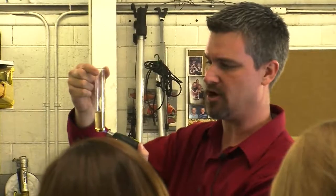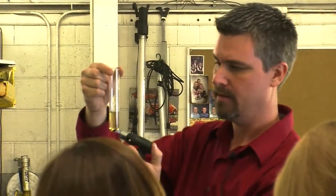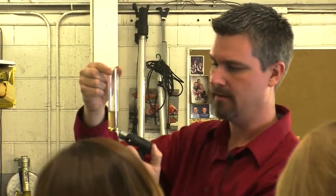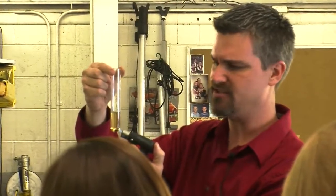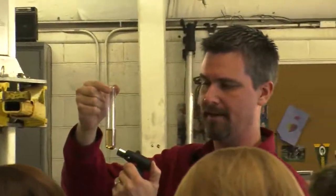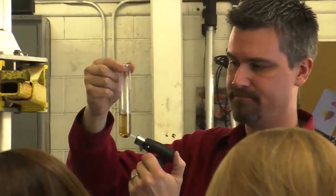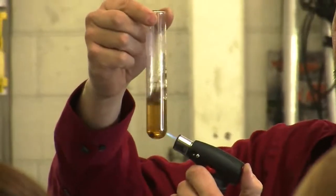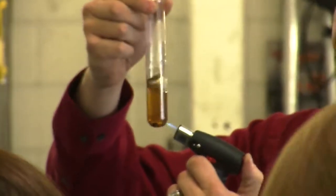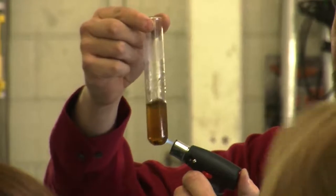We have detergents in here which help wear off the chemistry. You can already see the fluid starting to turn dark, because we're melting off that undercoat. And as we agitate it more, we'll see the reaction. But in a full-size engine you're going to spend about 15 to 30 minutes, depending on the buildup, to wear this down. You can see it's going to cloud up. As we go through this process, another minute or two here, we're going to have some good results.